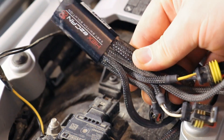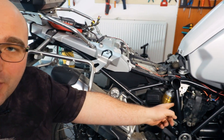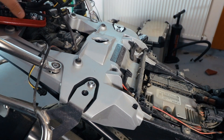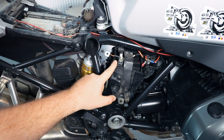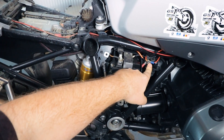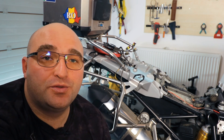Then take the second connector that came with the EasyCAN and plug in the original connector from the wiring loom that originally went into that sensor. Make sure it goes on the right way — there's a little notch that needs to line up with the connector's release clip. Marry them together and that's it. The only thing left is to power this by routing the cable to the battery. The battery's power cable runs all the way through to the battery — it has an inline fuse. The negative goes to the negative terminal and the orange positive one goes to the positive terminal. The EasyCAN is now part of the bike, communicating with the bike's computer.